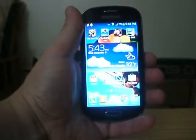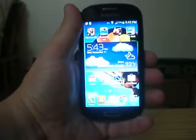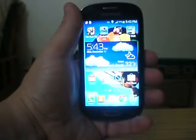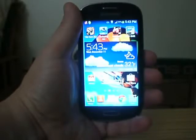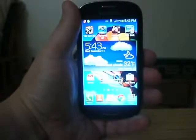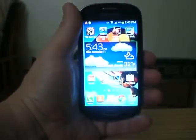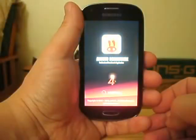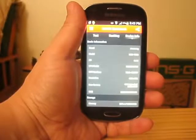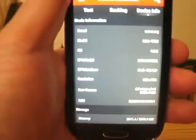Samsung did not skimp on the quality of what they put in this phone. The biggest and best spec-wise on this is the almost identical processor to the one sitting in the S3. From what I can tell online, nobody knows the exact name of this particular processor, but everybody's guessing it's simply a mildly updated version of the one in the S3, which is the Samsung Exynos 4 4412 variant. AnTuTu seems to back it up a bit by showing that they think it's an MTK MT6572, but the Mali-400 multicore GPU kind of defeats that and proves it is not that particular one.